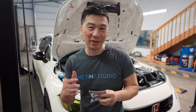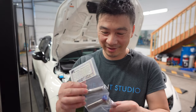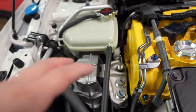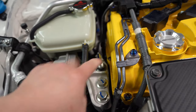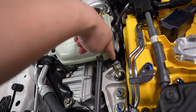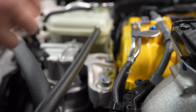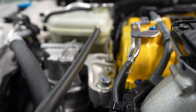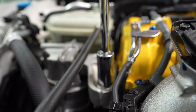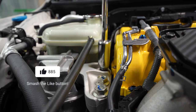We're pretty much done with the install — all the coolant is back in and the air is purged out of the system. But there's one more thing I want to do in the engine bay while we're here: the motor mount bolts. I got some beautiful ones from Chasing Jays. The motor mount kit only comes with these two bolts and this nut here. It doesn't include the battery bolts or the two bolts for the other side of the bracket, so I asked them to include those. I'm doing one bolt at a time — starting with this 19mm.